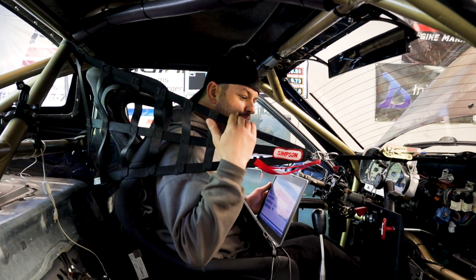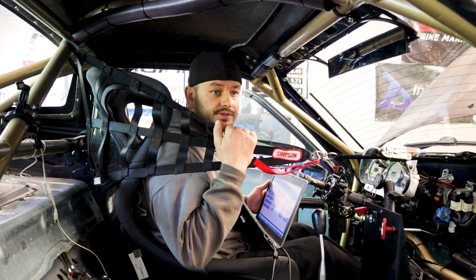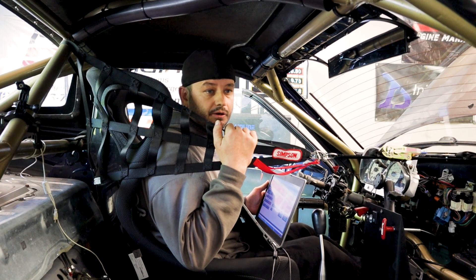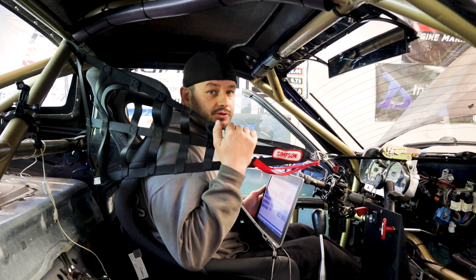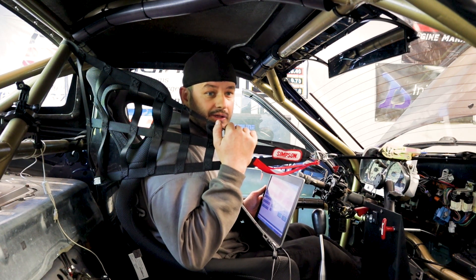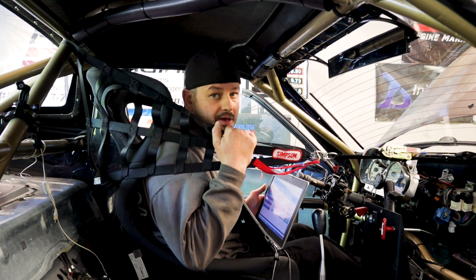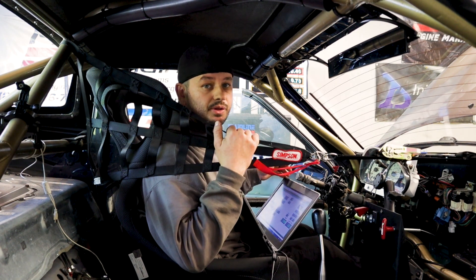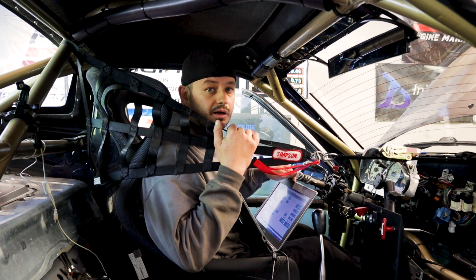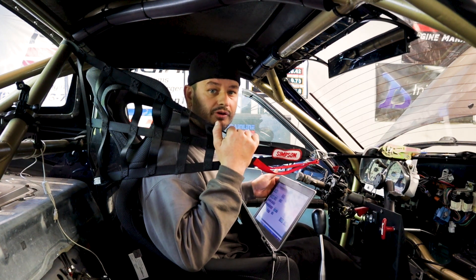This has already been set up, so basically just doing this video for the sake of doing the video — the timing and the fueling is all where it needs to be. It's not going to be changed, so all we're going to do is move the cam angle, make a handful of runs, and see the difference. We're going to start off at 50 degrees. It's also worth noting that all of the cam gear changes are just going to be made once it goes into VTEC, and the VTEC engagement point is 4500 RPM.